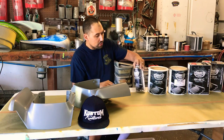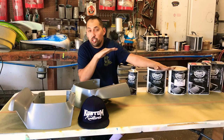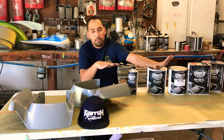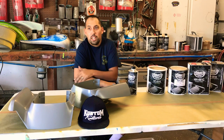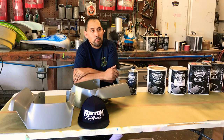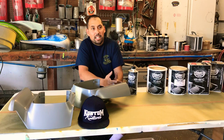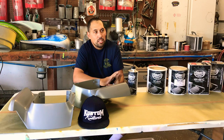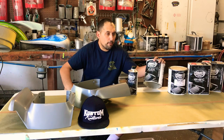This is basically your 5310 DTM. On this particular project we used the epoxy because everything was stripped down to bare metal. The main idea behind bare metal is you know what you're starting with. Sanding over previously painted stuff isn't the right way to go — sanding over stuff that's been painted twice or three times and then putting a basic DTM over that, stop doing that. You're layering so much material that the end result looks wonky, really thick on the edges and just weird. Try to get stuff sanded down — if not to bare metal, at least get most of that material off so you can start fresh. 5310 is very good at high build.